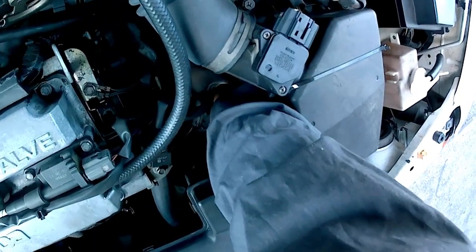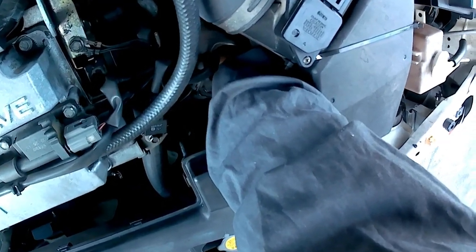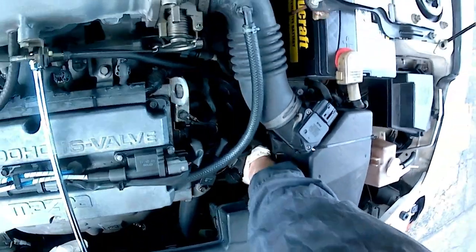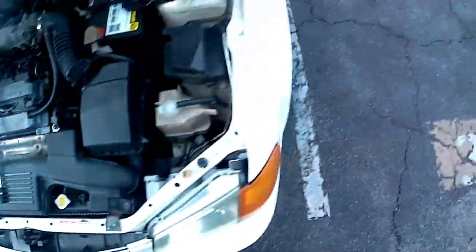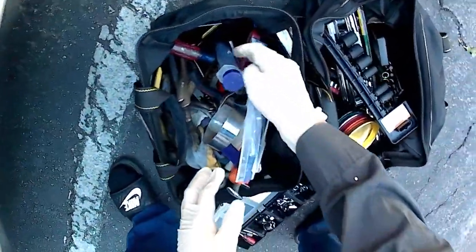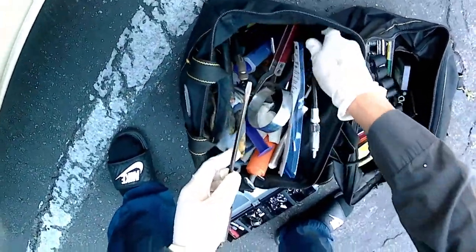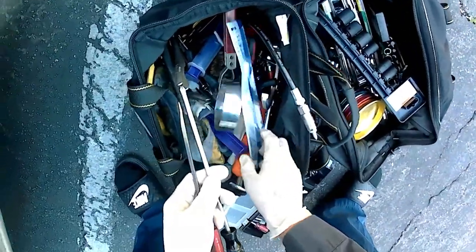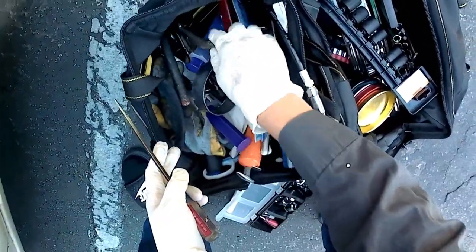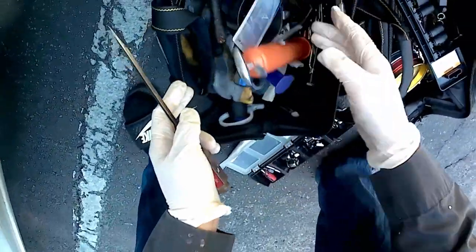Be careful with the plastic connector tabs because this car has 200,000 miles — it's pretty old. I was just trying to reach in and pull it out, but it's so old and original — nobody has replaced it. I tried to wiggle it out but it was so stiff. Prior to this, I'd been spraying WD-40 around that area. Every time I drove about 10 miles the car would jump to second gear and throw a check engine light.